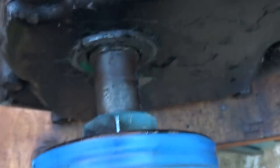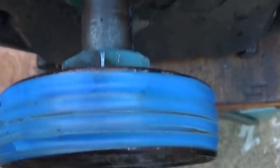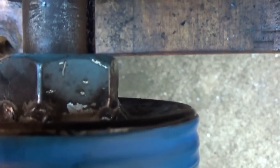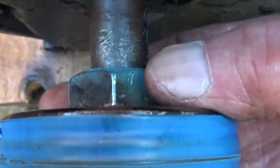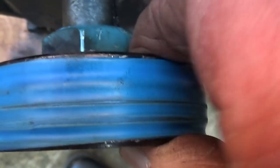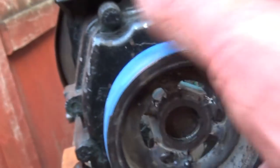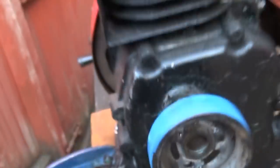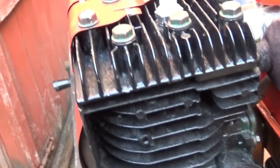I'll stop that by leaning it off. I'm not sure the tap stopped the petrol enough but it's getting better anyway. All I did - what I needed was a three-quarter fitting. I found a three-quarter nut, filed a little bit off the threads, and I had that pulley that we were given - welded it on there, hammered it onto the pulley and it's alright, it works properly.